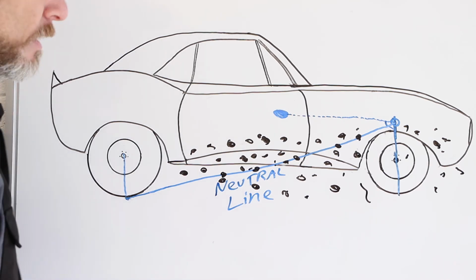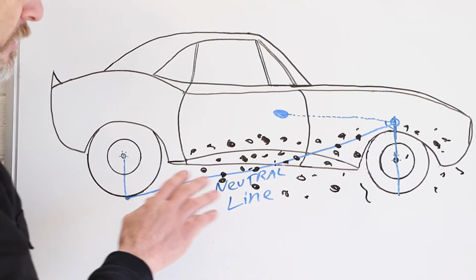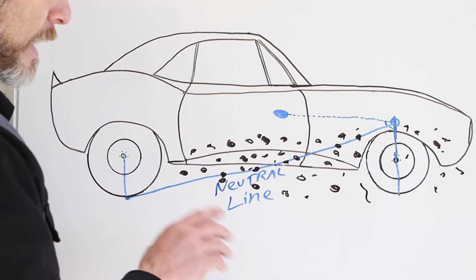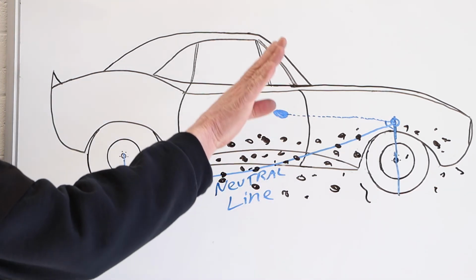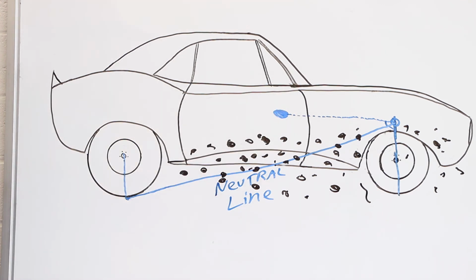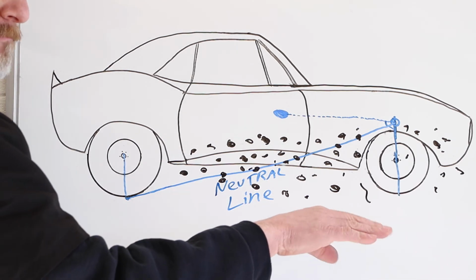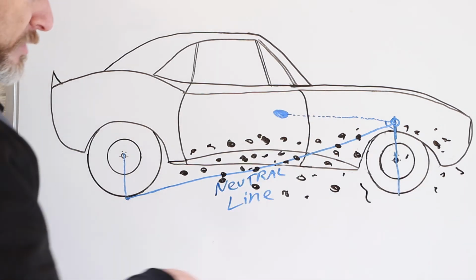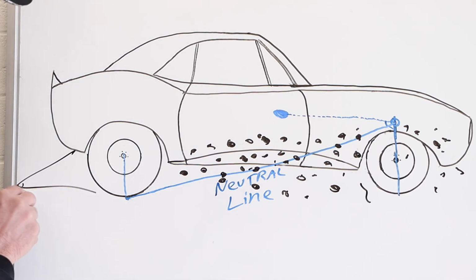You want all the energy to move the car forward down the track. Now you have to spend some energy doing things like planting the tire and getting the weight to transfer, but that's not energy sending the car down the track. These great big wheelies and wheel stands we see are all just wasted energy. If you notice, your fastest professional cars of today don't do wheelies. They'll get 100% of the weight on that rear tire and just skim the front tire on the track. It won't come up. Of course, they have wheelie bars, and there's tuning that has to be done with those too.